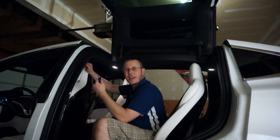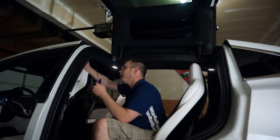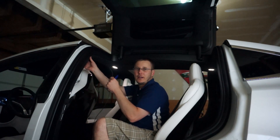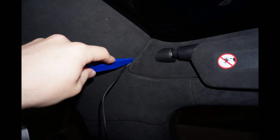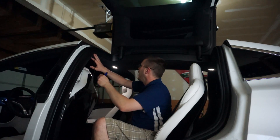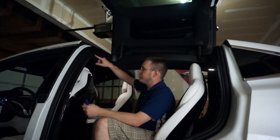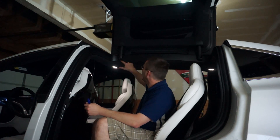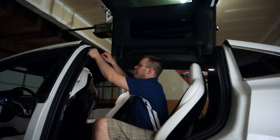The tricky part is running the cable to the back. The windshield is easy — there's a channel you tuck it right into. But then to get it through, you have to go down along this seam. Going across this pillar, there's a seam right here — pretty easy to tuck it in. And now to go around the falcon wing door, there's the same kind of channel that you can easily tuck the cable right into — very, very simple.